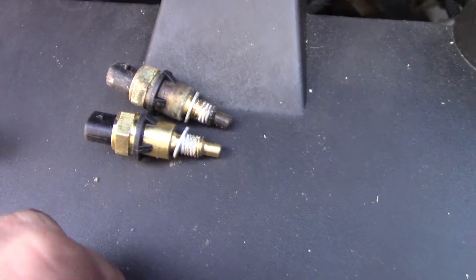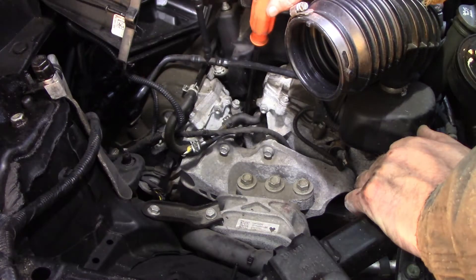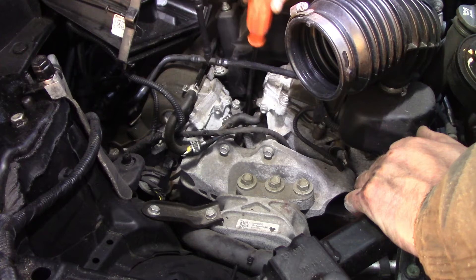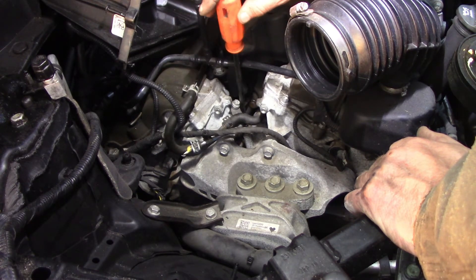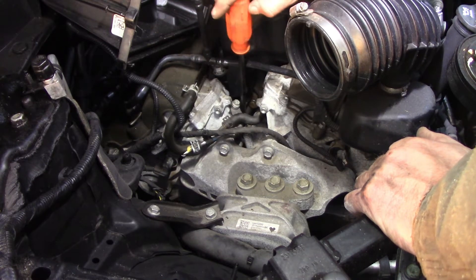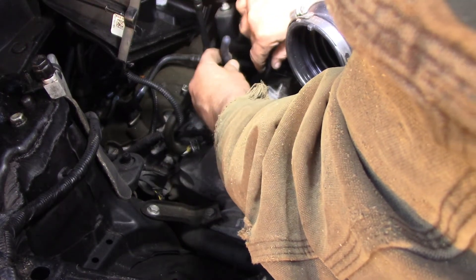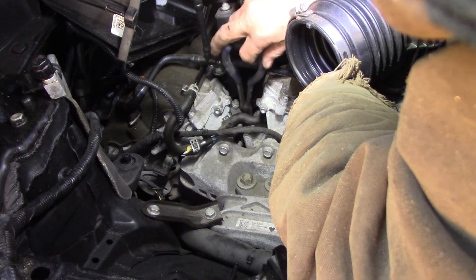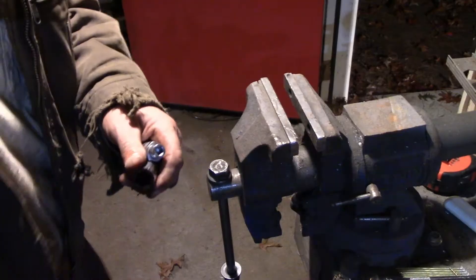I'm definitely starting this carefully — going real easy with fingertip control. Give it a little turn; I can see it going in. Just wiggle it a little bit. It does have some kind of Teflon tape or goo on there, so it's going to start getting tight. For right now we're just using a flat-headed screwdriver into the sensor location hole and it is threading in. Maybe I'll get a pair of pliers down here and give it a couple turns like that, until we get it seated. We could also just use a long pair of needle nose, give it a quarter turn at a time.